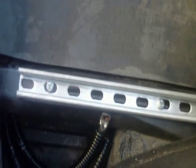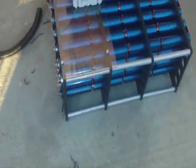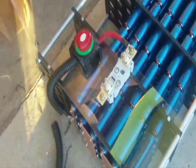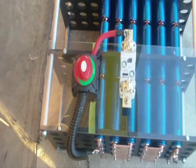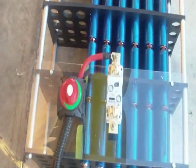So we have set up our boot area here to install the Headway traction pack. Got our two pieces of strut in here where we had the old tray for the lead-acids. We have installed a bit of matting to go onto the boot floor. So what we are going to do now is basically drop our pack in - we have fitted our fuse and shut off there. We are going to get that in, hook it up and go for a quick spin.